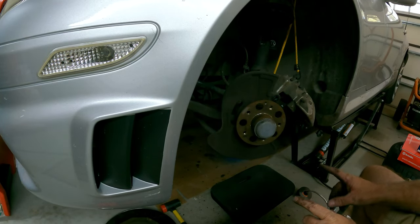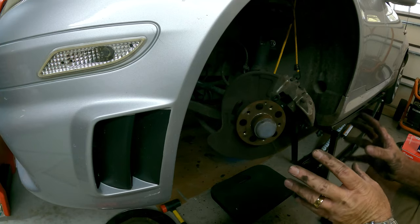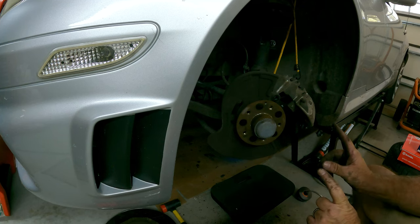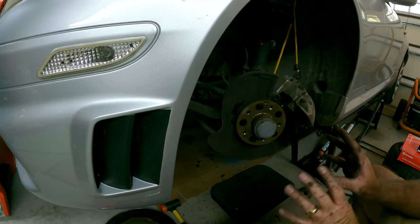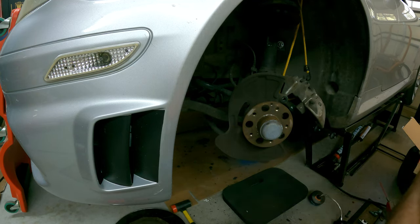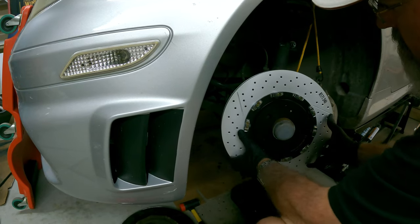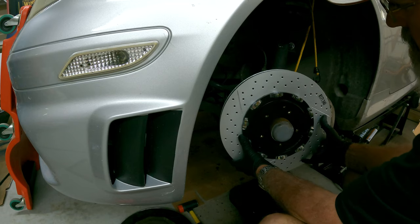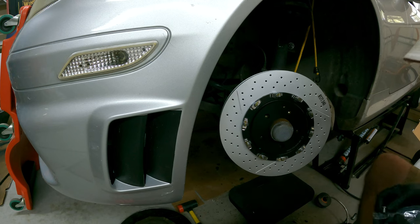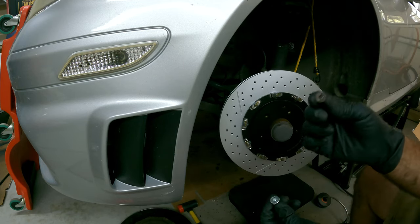Now what I'm going to do is put on gloves because the coating that's on the rotors — I don't want to get grease or anything all over those. So I'm going to put the gloves on and put the new rotor on. Let me go ahead and get some gloves on, then we'll pull the rotor out of the box, slap that bad boy on there, and go ahead and button this job up. They've got a new locating pin in there. Put that in there so that the pin will go in there. The new pin is an Allen head; the old one is a Torx.